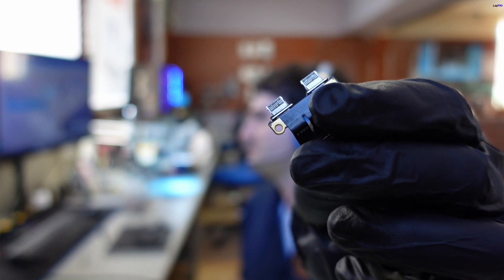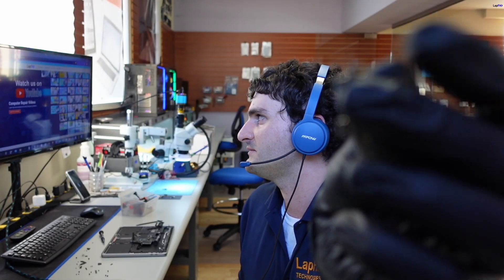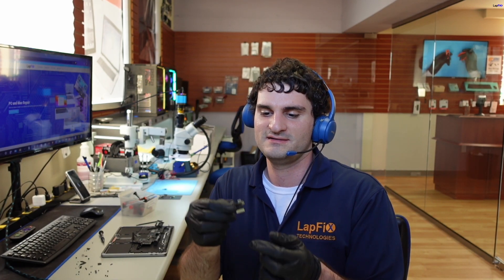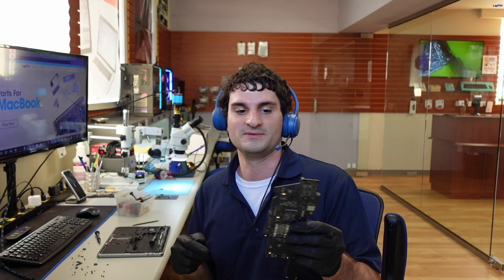And of course we do have a problem — it was pretty obvious when we opened it. There's no voltage because there's a problem here. You can see the lines don't look too great. There's corrosion from the liquid spill. The darkness is because it started to curl a little bit, and electricity trying to pass through — maybe a power line, maybe a data line — is getting corroded. We definitely can't use this port. Let me take a quick scan of the board to see if there's anything else.